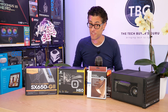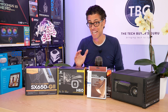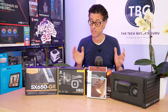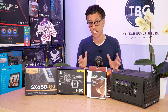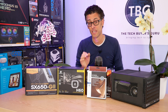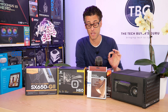I feel like I found the holy grail for cooling in the Silverstone SG13, one of the most popular ITX cases on the market. It does demand liquid cooling, but not just stock liquid cooling. While the H60 on its own was decent thermally, the noise levels were out of control — the stock fan is, to put it simply, trash. When I upgraded it with the $30 Noctua fan, it completely changed the characteristics of this cooler. It was much, much quieter — on a level with air coolers — and yet the temps were even better than with the stock fan. A total win. I recommend using the low noise adapter so it runs at under 1700 RPM.